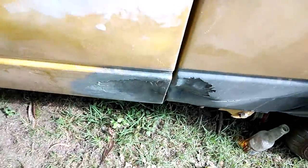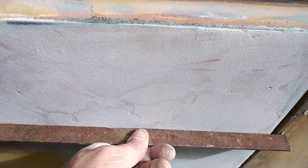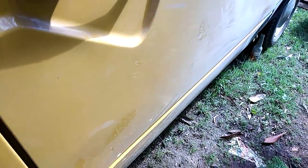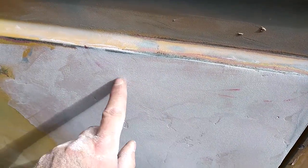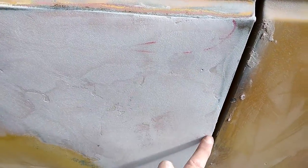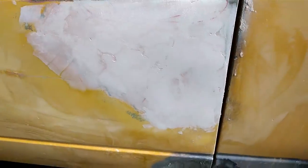So we're going to have to fix that, but this one wasn't too bad. I've actually just body filled it up with our bog or body filler. At the moment I've used the orbital to bring the surface down. You can see I've used a texta - a Sharpie pen as I go, and when I filled it I noticed it wasn't quite right. So I've put a couple of Sharpie marks on it so I know where to put the filler. I've put two little coats of filler on that and it's come up reasonably well.